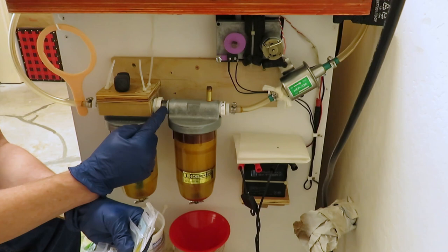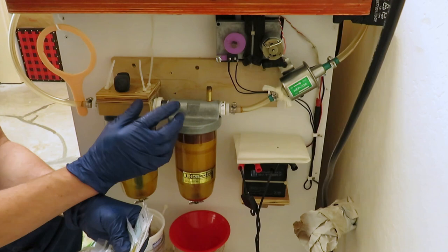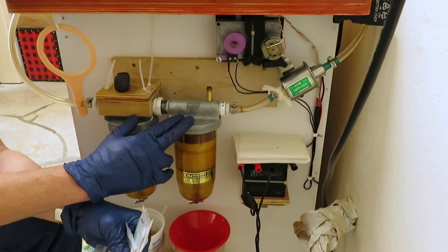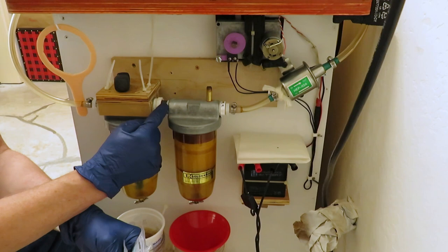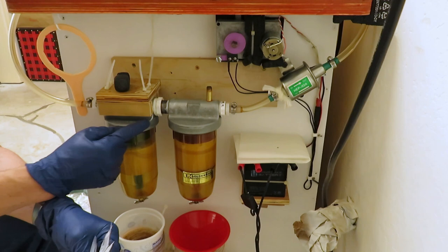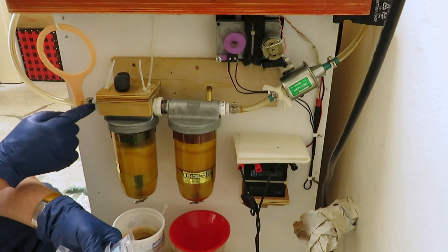The rest of it are just close fittings and adapters from the plumbing department. These come in three-quarter inch and one inch. I could only get one of each, so this one's three-quarter and this is one inch — that refers to the threaded piece on each end. I have an adapter to go from three-quarters to one, and this side has a three-quarters down to five-eighths for the barbed piece for the plastic hose.